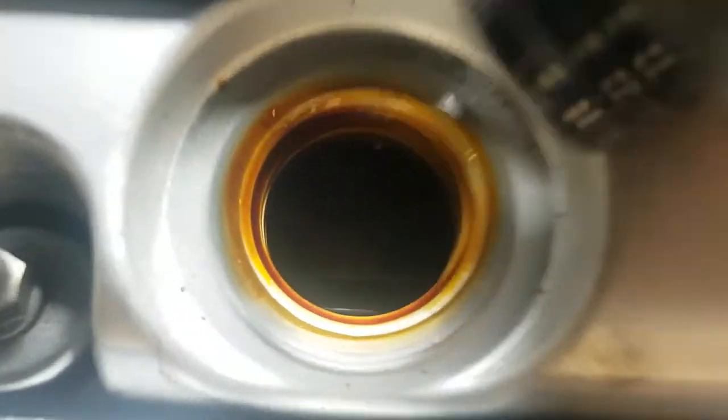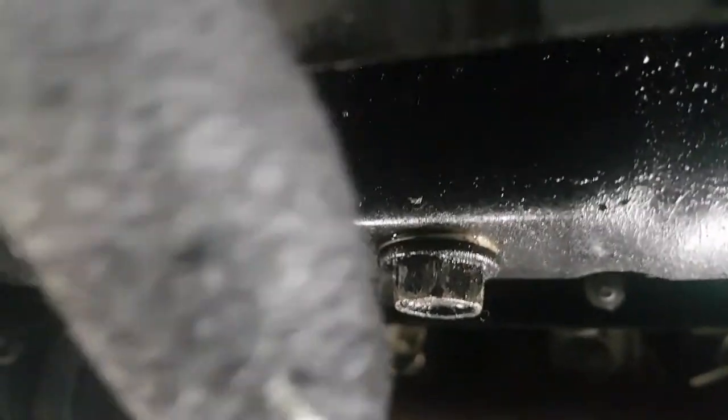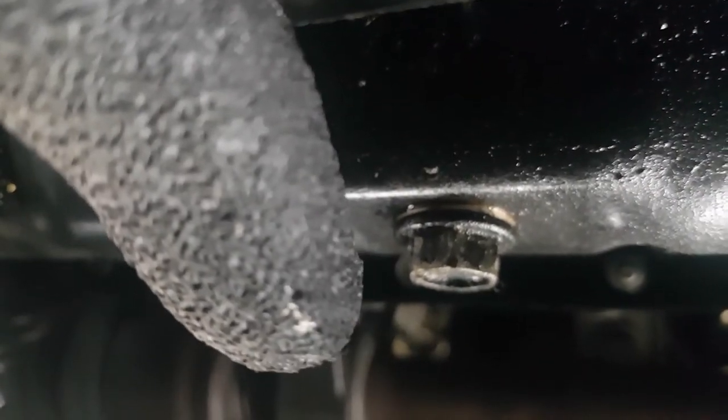I've just been underneath — I cracked the nut with the socket, it's just sitting in there loose. The next thing you want to do is open up where you pour the oil in at the top. Sorry about the quality — I've got my drain pan ready. I used the 17 millimeter to crack that bolt right there.